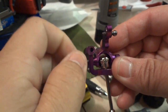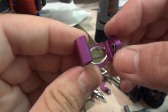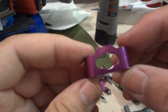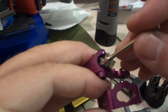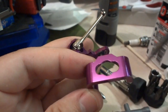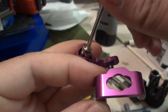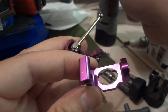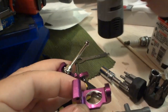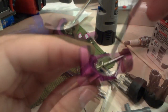I'm going to show you guys — I'm taking this apart. It's a little painful but that's what I had to do. Once I milled this, the way it was before was like this. What was happening is the edge of these new CV joints was hitting this edge here — it was hitting on the outside, getting caught right here, so it wouldn't allow it to completely turn. I said well, it's gotta be done, so I took my Dremel 7300 with my drill bit and just started drilling away, milling down until I cleared out these little bumps.